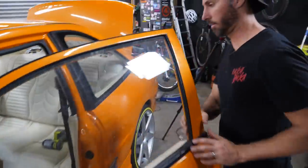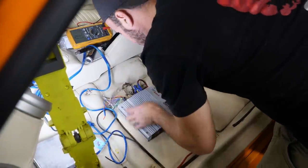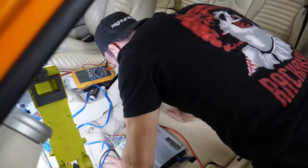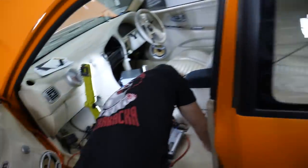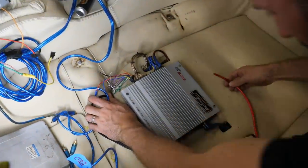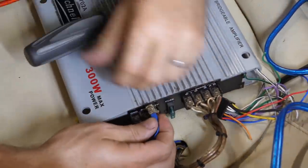So now I just need a Phillips head. Yep. And we're going to replace this big blue one down here, but what are the other ones going to it as well? Why are there so many wires going to it? I reckon someone's run all the downlights and stuff off that main power feed. Yeah, okay. Yep, I reckon, because that's the only thing I can make sense of, because the other amps and stuff don't require it. But it's a bit of a cheater's way to get clean battery power into the car and then out into your other stuff. We can do a continuity test to make sure that it is actually getting the chassis, but I'm almost certain that it is, based on all the random bits of wiring hanging around down there.